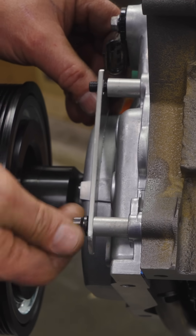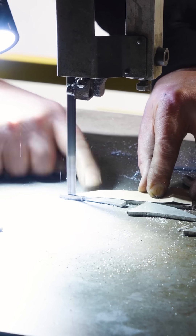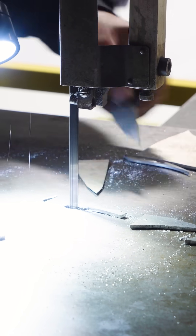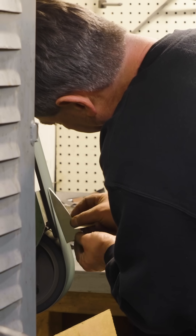I just fabbed one up while the head was off so I could get a true top dead center, and that way I could shoot a timing light on it and verify that what the engine is actually seeing compared to what's in the program for the MSD box.